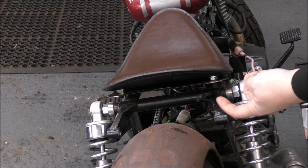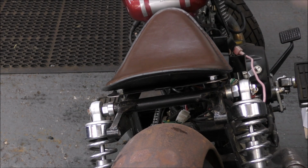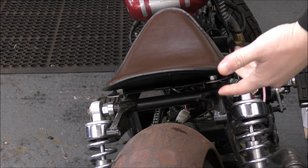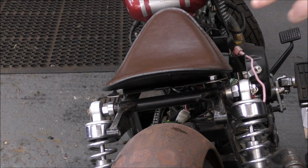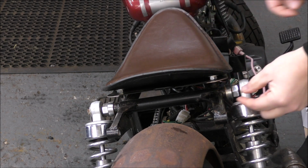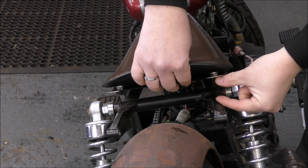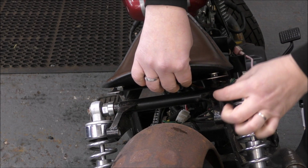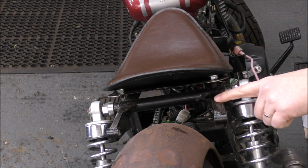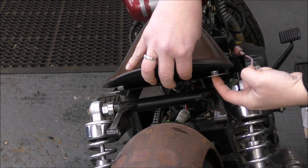So when it comes to mounting this plate onto this frame, we have a bit of a dilemma. We had that plastic, what's it called? It is plastic, but strong plastic, a block that you can screw a thread into. Now we might, because it has to come up a slight touch, make a block, put a thread in and have two round little blocks on here, or we need a bracket and we can weld the bracket to the frame and then it goes up here and then up here and then bolted to this.